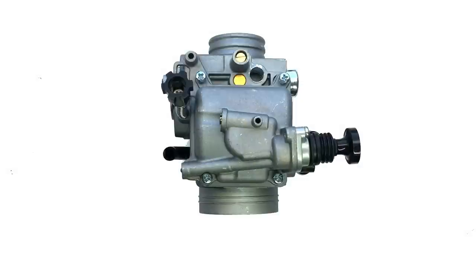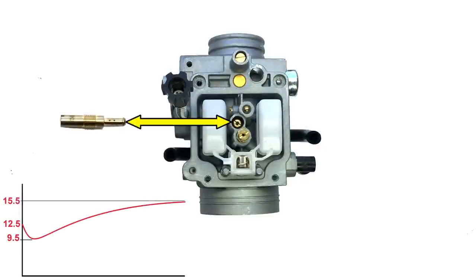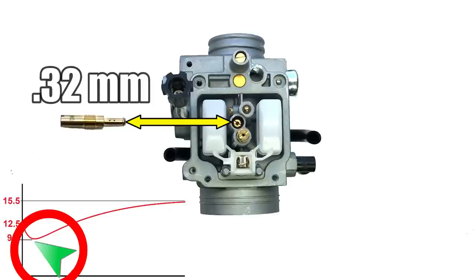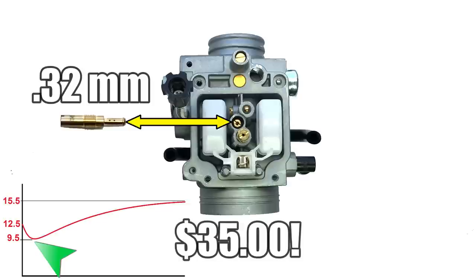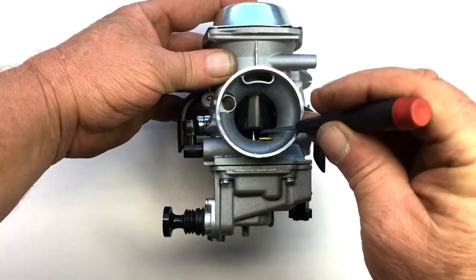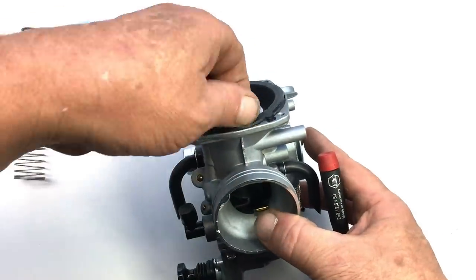Let's take a look at the pilot jet. This is the bottom of the carburetor, and over here is the idle mixture screw. Let's remove the float chamber and take a better look. This is the pilot jet, and it's responsible for the dip in AFR. The jet that came with the carburetor was a 0.50mm, and we tried a number of different smaller jets, finally settling on the smallest we could find: a 0.32mm. It's hard to say what effect this had on the dip, because no matter what we did the dip more or less stayed the same. Perhaps something smaller than a 0.32 would work, but that's not something easily available on short notice here in rural Kansas. There might be something going on with this $35 carburetor that prevents the smaller pilot jet from making a difference.